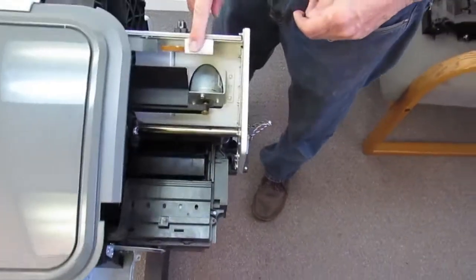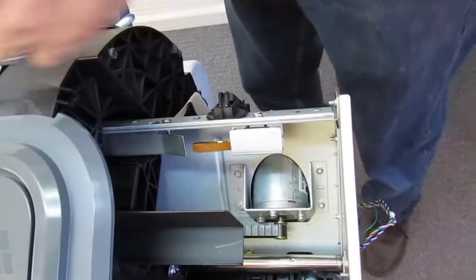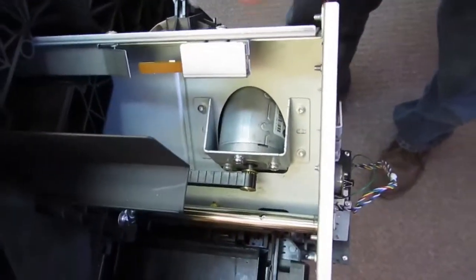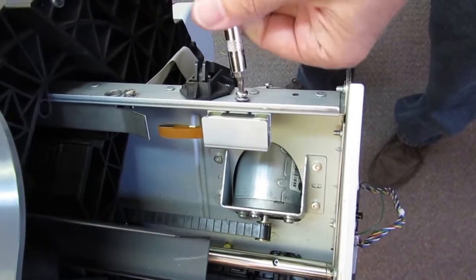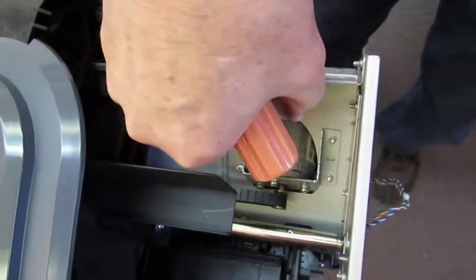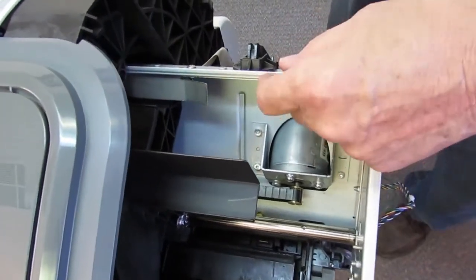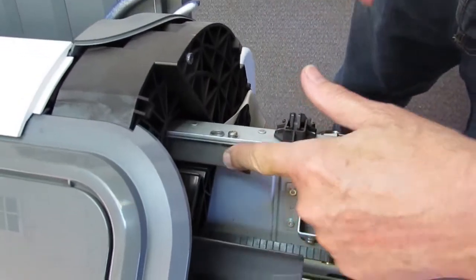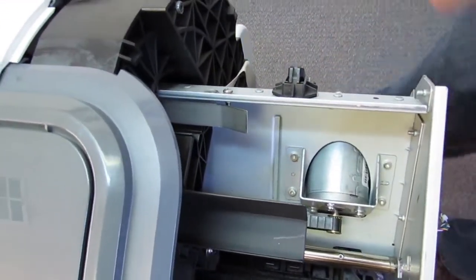This is an oiler finger here. It looks like a switch actuator but it isn't — it's got oil on it. So we're going to take that off. This actually sits right on top of where the bushing goes on the carriage; its job is to keep that bushing lubricated. It's got one screw at T15 and comes right off. Now this hides one side of the bushing — the clip side.